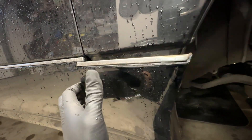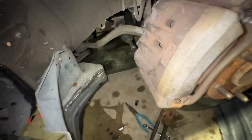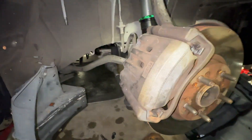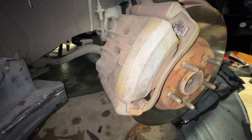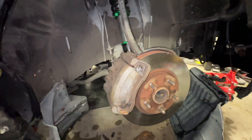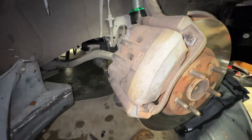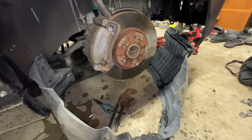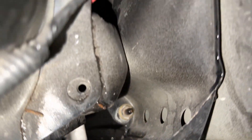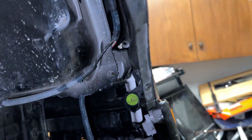Use a flat head, use a tool — just be careful, not trying to break any clips. I pulled the fender liner and there's one bolt holding right there, so I got to take that out. So this car is lowered. I'm only going to reuse half the fender liner to cover the headlight area down to the bottom. I'm going to take all this out because we're going to be kind of low and we don't want to rub into the fender liner. We're going to roll the fenders on the new ones. Now the next bolts holding the fender are right here — the bumper one right there. Take those two out and the rest should be pretty easy with long extensions.